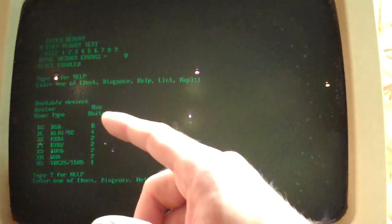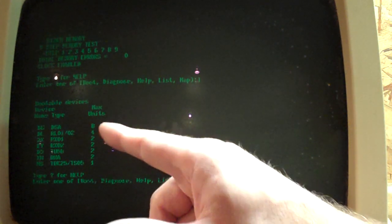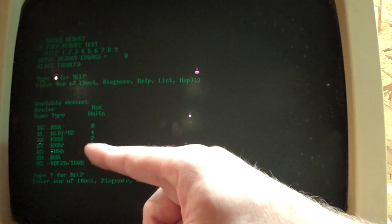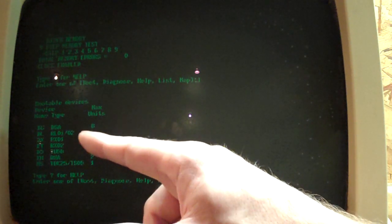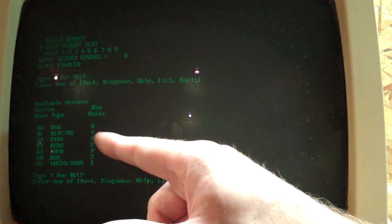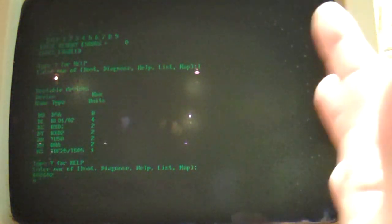So we can list devices. Now, this is devices that are in the bootstrap, not actually attached to it. All this has is the dual floppy drive and the internal hard disk. I'm not actually sure what the floppy drive comes up on here, because I know it's not an RL01 or RL02 — those are removable pack drives. TU58 is tape. I don't know what this is, and this QHA might actually be SCSI, maybe. The RX-01 and RX-02 are floppy drives, so it's probably one of these — probably an emulated RX-01 or RX-02, because the real ones are massive 19-inch wide monsters that sit in PDP-11 racks.